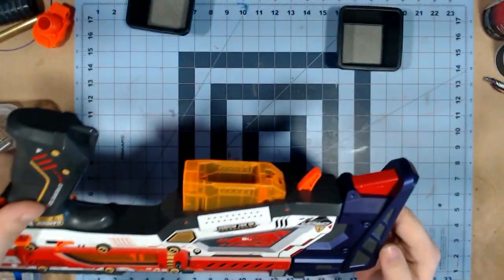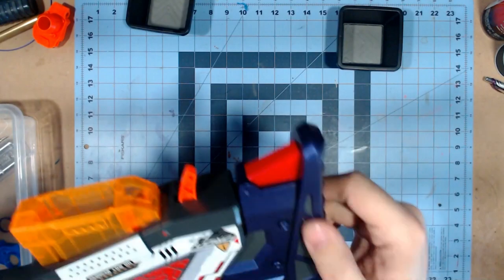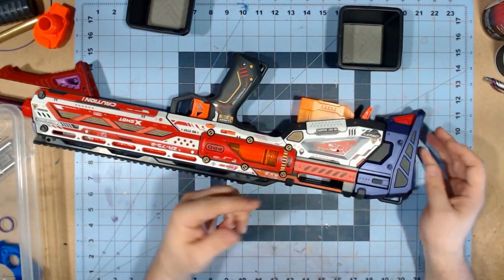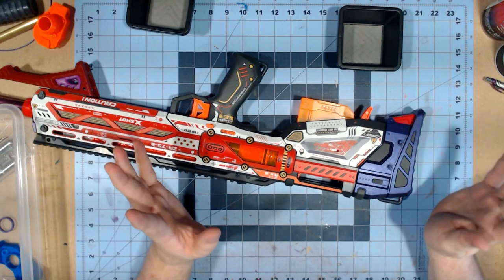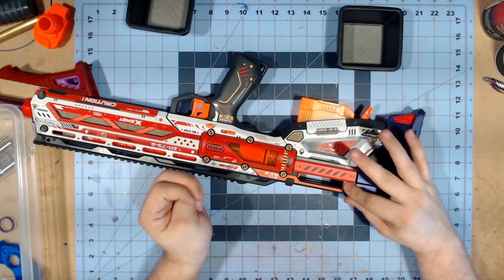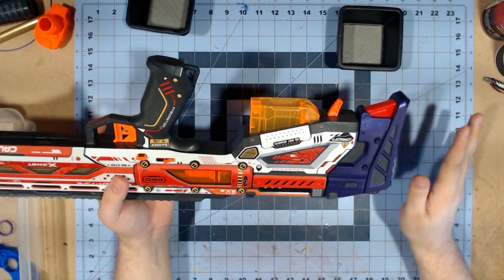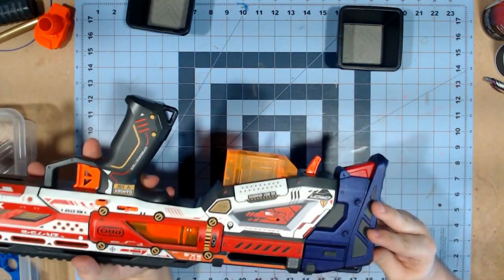However, I did notice there was a little bit of tackiness on it after a while. You can actually see where I did my nail scratch tests, and there was a good scratch in a couple of spots. When I went to tape it off, the vinyl dye actually peeled right off in one little piece, which got me bummed. But I repainted that, let it sit for a few hours, and it set up right. Yes, I've been doing this for years and I'm still as impatient as ever. Once the vinyl dye was set and I got everything taped off, I did my metallic purple lacquer on it, and the rest is golden.